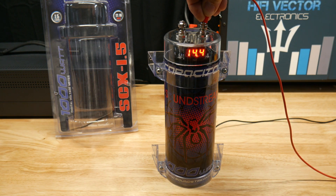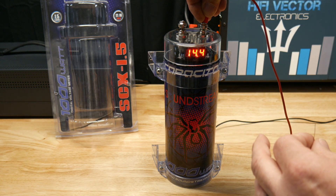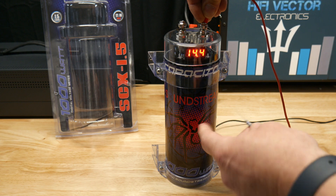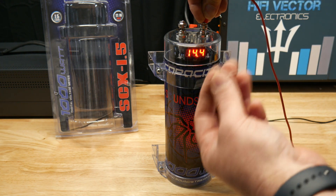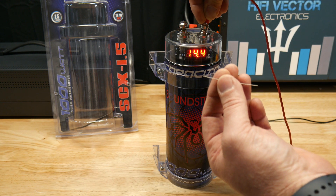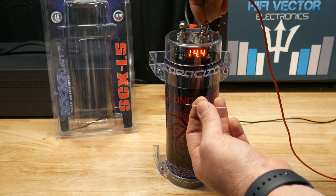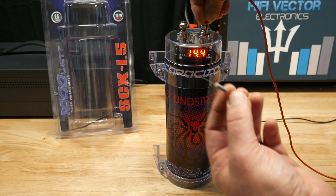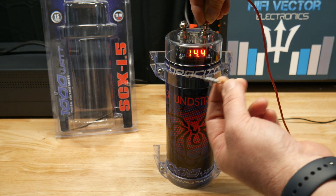The reason why you also have to discharge them: not all but some caps — you may have heard stories about guys' car batteries going dead. If they don't drive it that much and come back in two weeks, the cap can start leaking fluid. Caps are also sensitive to voltage dropping too low for a long period of time. That's why you use the resistor to discharge them so the voltage drops out right away. If the battery slowly died over days and the cap sat at eight volts for a long period of time, that will also damage the cap. So if you're disconnecting your power cable or changing your battery, you need to discharge it first so no damage occurs.